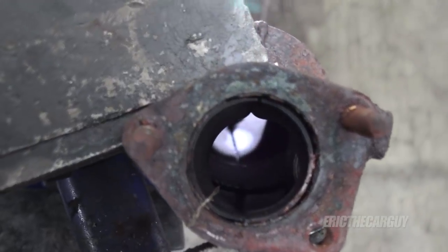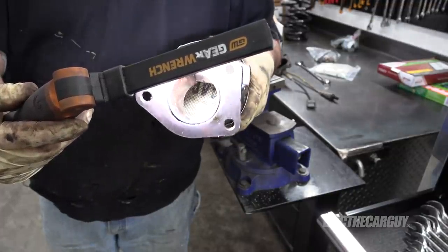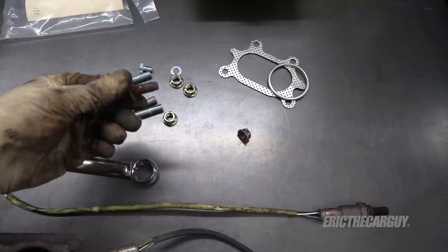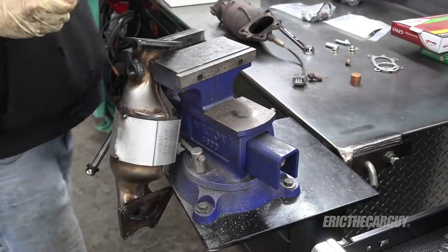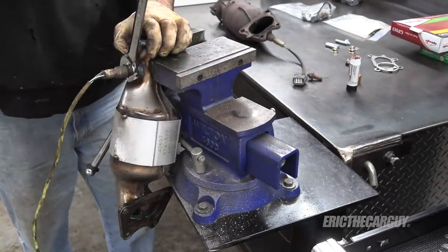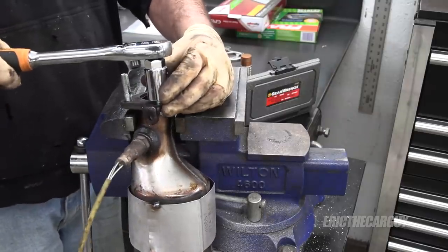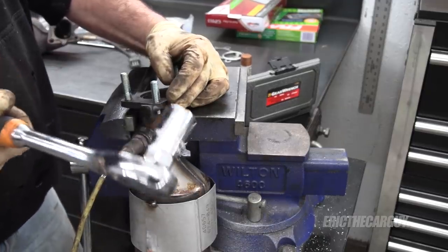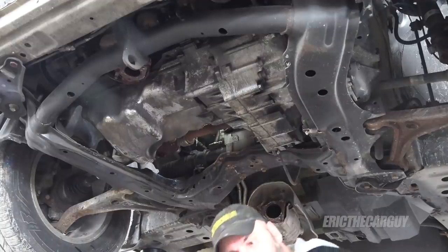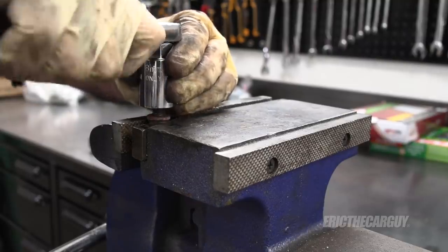For those of you that might have missed it, there's nothing in this catalytic converter — it's just a big old fat pipe. Here's the new converter — this is what it's supposed to look like inside. Here's the part number for the new converter. The new converter came with new studs, fasteners, and gaskets — actually the same studs as what was in there originally. I'm going to reinstall the O2 sensor with some fresh anti-seize and do the same with the new one. These are sockets designed to install studs — I'll put links in the description. I might as well take these studs out to make installation of the converter that much easier.